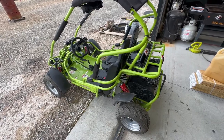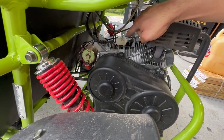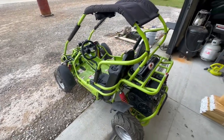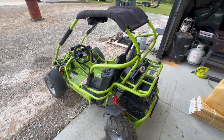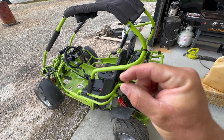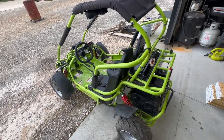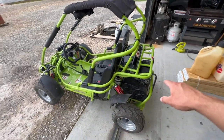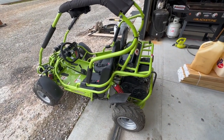On to the modifications — this first one is more of an upgrade. See that white fuel filter right there? I used a name-brand fuel filter; I had Kohler filters sitting around and I know they make quality units. Briggs & Stratton, Kawasaki, Onan — get a good quality fuel filter, because the one that came on this literally has a mesh with holes that big. All it'll catch is large particles like leaves; it's not going to trap sand, gravel, or dust, and these things kick up a lot of dust on gravel.